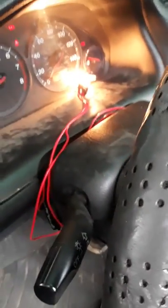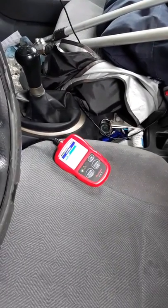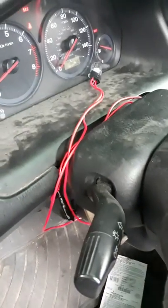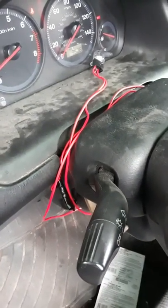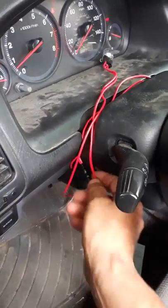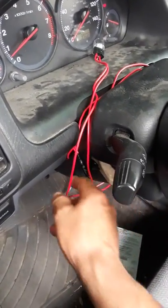See that light? If my fan is actually working, that light means the cooling fans are on, and it is coming on at about 170 to 172 degrees Fahrenheit. I wanted to know when the fans were coming on, so I did that. One of these wires is hooked up to ground, the other one goes all the way to the fan relay.